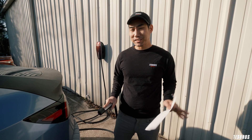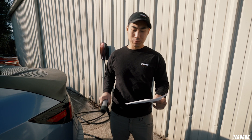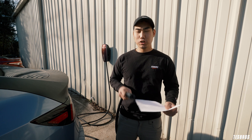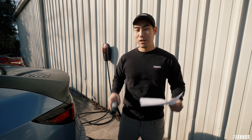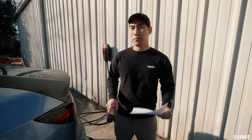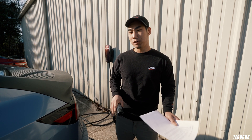Hopefully, that helped you guys cover the basics of charging. The first tip: your battery percentage will differ based on weather and terrain, so try to keep between that 20 to 80% charged. Try not to go below 5%. You want to check your weather before you leave — weather does affect battery range. The other thing: charge to about 80% for 2021 or earlier years, but the newer ones with the LFP battery made in China — Tesla actually recommends charging all the way up to 100%. If you have any questions, let us know, and please help us out by subscribing. Until then, we'll see you next time. Stay charged.